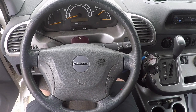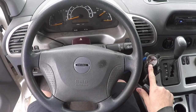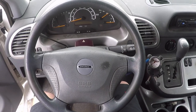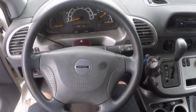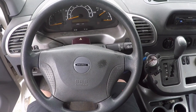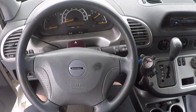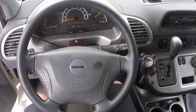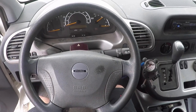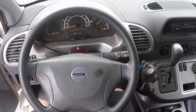I installed a pressure gauge in my cooling system — you can see the gauge to the right of the steering wheel — just to monitor how the cooling system pressure behaves under normal operation: when the coolant's cold, when it warms up, and when I'm driving gently versus harder under boost. I've seen symptoms where it appears the cooling system is being pressurized, and it seems like it's happening when the vehicle is driven hard under boost.